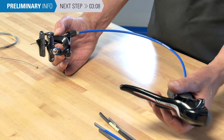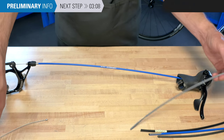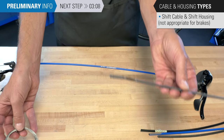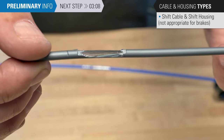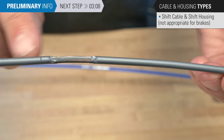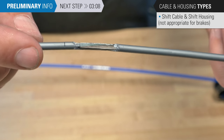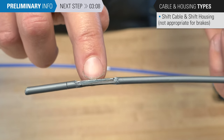There are certain housings that are appropriate for a brake system, as well as certain cables. Let's first look at some that are inappropriate. This is a smaller shift wire, about 1.1 millimeters in diameter, passing through some smaller housing that is shift housing. We've cut away a section of the outer protective plastic sheath to show inside — that's the support wires that run in line with the load. In braking, it is very inappropriate because we have a lateral force, much more force, that could blow right through these wires.